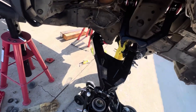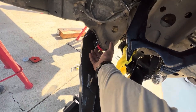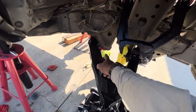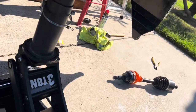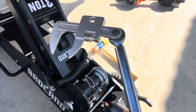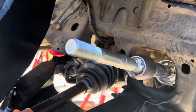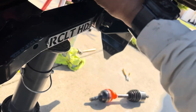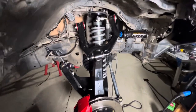It's still kind of loose — I gotta find a way. I might have to put an access hole at the top so I can tighten it from the top, because I can't get anything back there. The existing nut with this welded on back here is in the way. I just put this on here and torqued it down, put this on here at a 90 and torqued it down to 108 foot-pounds. I turned the steering rack so the shaft would come out since it's too close on the frame, then I slid the boot over it, got everything on, turned it back in, and zip-tied it down.